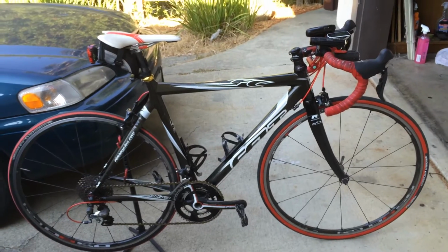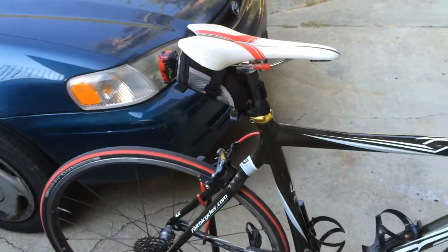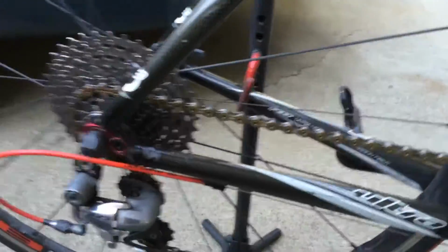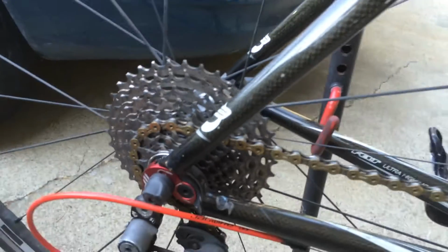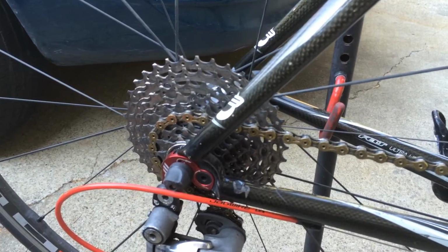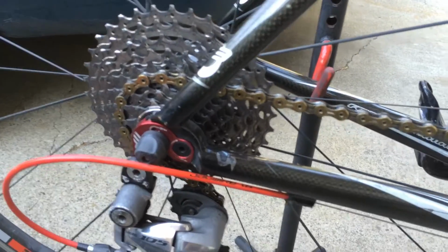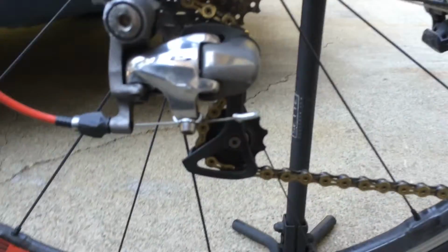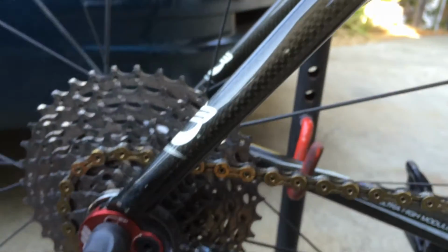I thought I'd give you guys how I set up the bike for that massive long ride, or any long rides. Most important thing, this guy. It's a 36 tooth cassette. How I'm running that is, and notice I've got a short cage, but I'm running it with this thing, and that's a Wolf Tooth Road Link. Basically gives me the clearance.